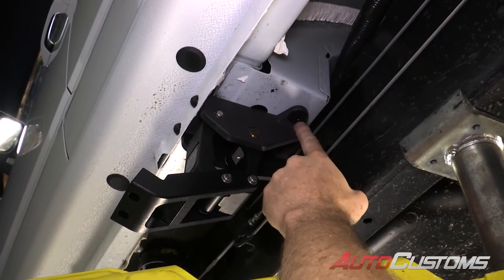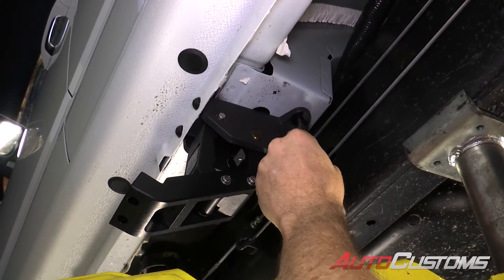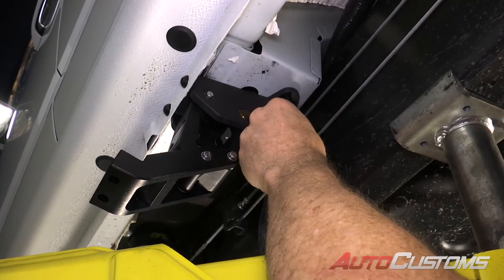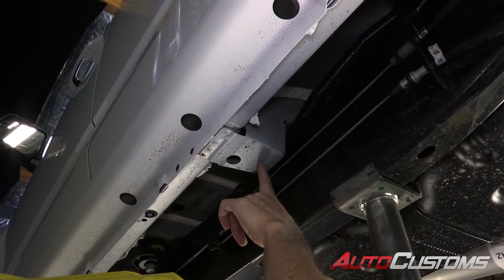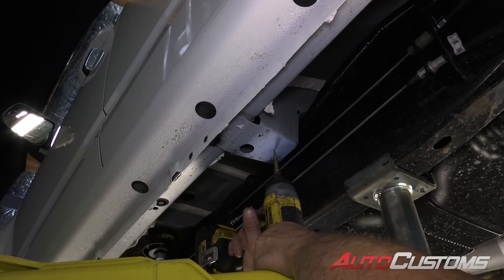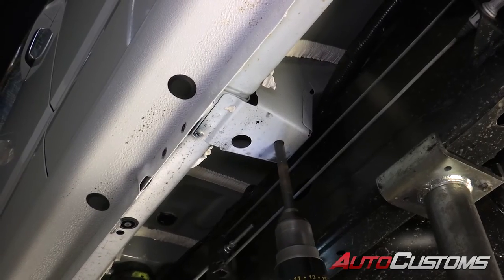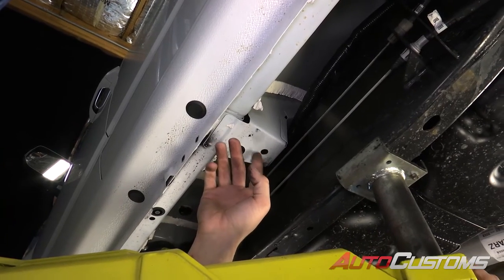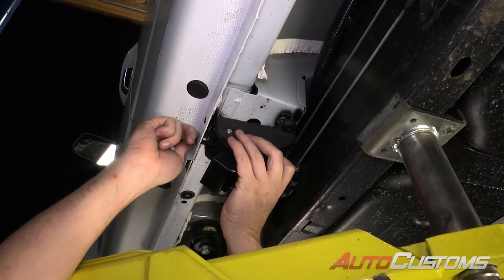We're going to notice that the back end of the bracket has a hole lined up directly underneath the cross member. We're going to take and set a center punch right into the middle of it and pop it in place. Now I went ahead and took the bracket back off so I can go ahead and drill. We're going to step this up to a 17/32nds, then install a rivet nut after we spray it with some paint to make sure it doesn't rust. Just like on the front bracket, we're going to hit the new hole with some paint so it doesn't rust and then install our rivet nut. Now we can go ahead and reinstall our bracket using the same provided hardware.